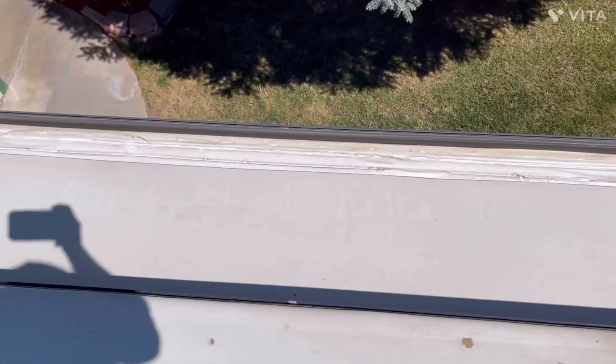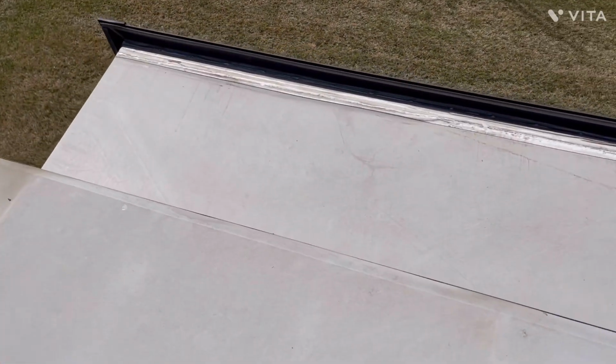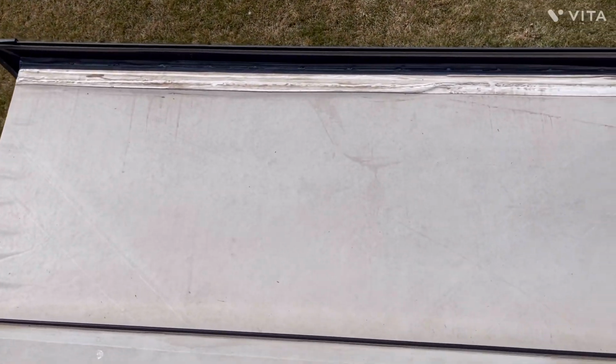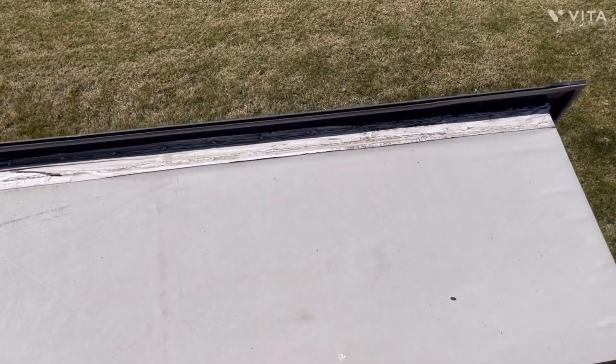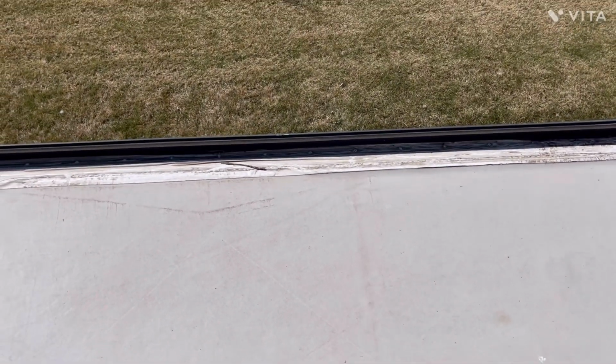And a quick look-see on the slide. And that 1 main slide looks good for the 4-inch Eternabond tape out at the outer edge. And the TPO covering looks good. The D-seal looks good all along the edge up there. And I'm not going to bend over and hang my head down, but the wiper seals look good too.